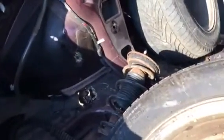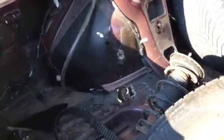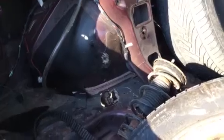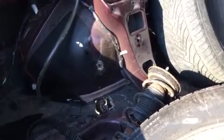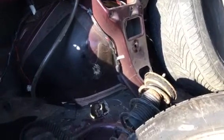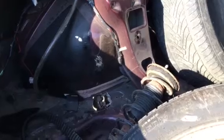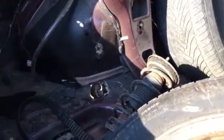The confusing part is going to be putting them back in in a way that's going to be easy to fix-weld shut. That one has the extra hole in the side where I cut initially, thinking I would go in through the sides — kind of giving myself a practice run for cutting into the side of the frame on the final car. I was intending to go in from the side and weld it shut so you don't have to deal with cutting out braces, but it's looking like I may have to cut the braces and go from the top. The top is way easier to cut through — the sheet metal is way thinner, like 16-gauge steel, whereas down here you're dealing with multiple layers of steel.